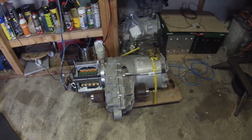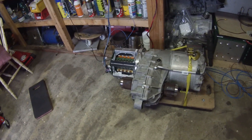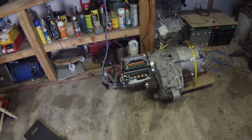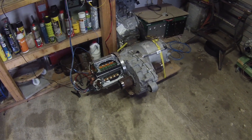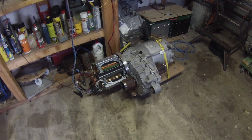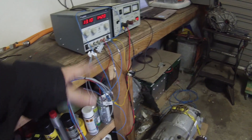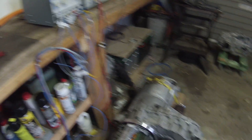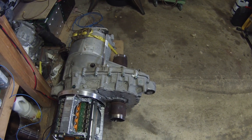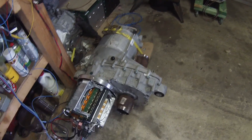One of the advantages of the Tesla motor is that it has such a low impedance that you can get it up to really high RPMs with very low DC bus voltages under no-load conditions. The condition we're simulating right now is: you've jumped in the car, you've got your foot on the brake pedal, and you've just turned on. So what we're going to do now is release the brake — I've got a bunch of wires here, I really need to build a little switch panel — so this is us sitting on the brake pedal. Brakes off, and we go into creep mode. This is now running forward, by the way.